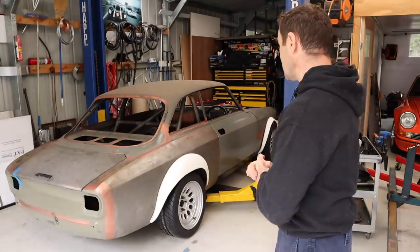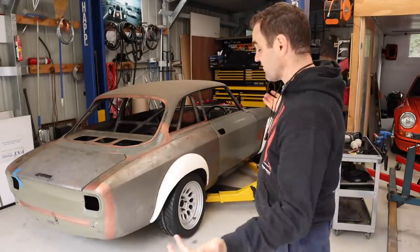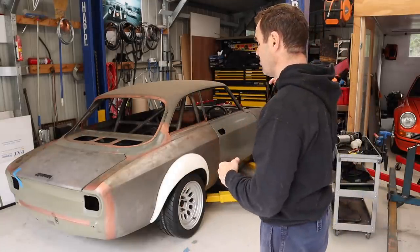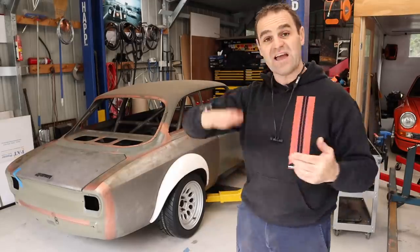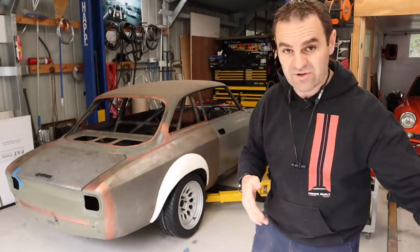All right, getting back into it. A couple of points from last week. I did put in the drive shaft, the tail shaft, into this car, and there were some questions on why I didn't go a one-piece tail shaft. It doesn't have the articulation, so it would hit the body. I'd have to remake even more of the tunnel than I did.